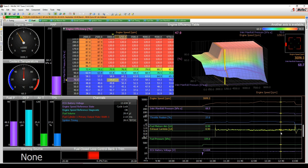All right, and if you dial in your closed loop, that makes it much easier. So what I'm going to do is just a quick ramp run. This isn't what you'd normally do when you're tuning, just to save you that basic setup that you can do yourselves. But I just want to show you a ramp run and how you can very quickly get the efficiency map in shape with just a few pulls on the dyno,